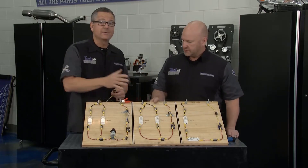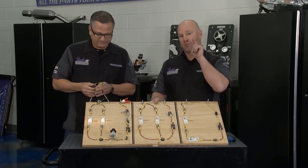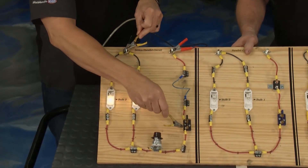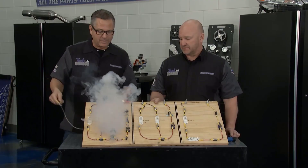Hosom definitely hit it right when he said don't put a bigger fuse in, because I can show you what's going to happen here — great question to ask. You don't want this happening on your truck. This is a smaller wire. Instead of a big fuse, if I burn that — there it goes. Not good. You're going to burn your truck up.